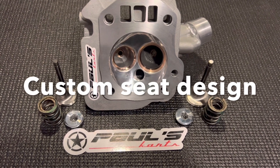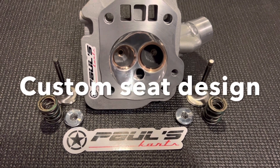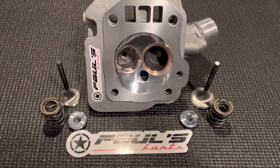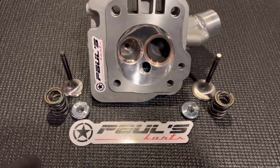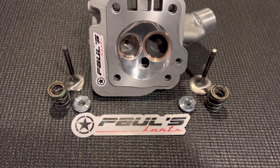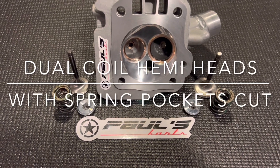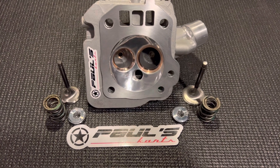The custom seat sizing means they don't intersect, which isn't really an issue in the hemi heads but in the non-hemi heads it is an issue — so it just makes them even more stable. Something like this hemi head comes with the 3228 valve train setup, dual coil springs, and he actually has the titanium retainers — these are just some billet ones here while he's taking pictures of the head.